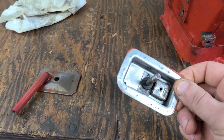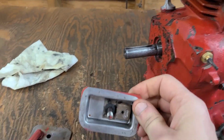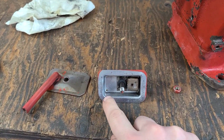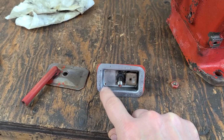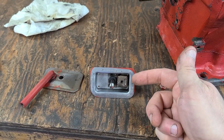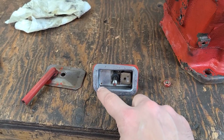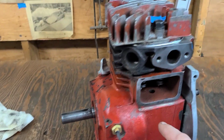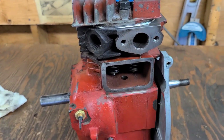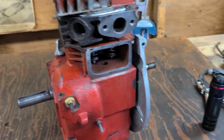There's actually a back pan piece that goes in like this. There's a gasket, and then there's another gasket, and then the lid goes on top of that. We just want to make sure we situate it correctly with this little hole towards the bottom, so that this little popper goes back and forth with the changing pressure. If any oil gets sucked up into this, it'll drain back into the lifter area. It ultimately will go back down this big hole, so it's really not that big of a deal. Screw it in, snug it down, we should be fine.